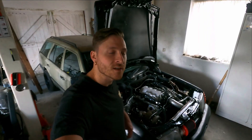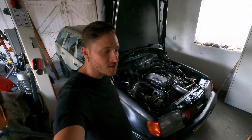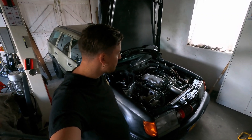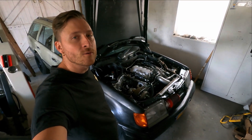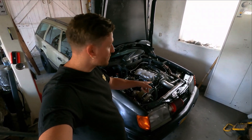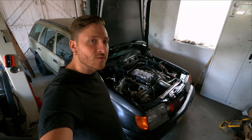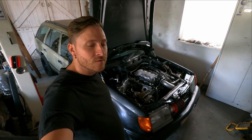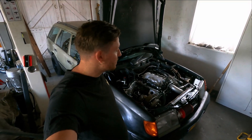Daniel said it can still run a lot of timing with this fuel, and this is a low octane fuel setting. So normally you should expect at a certain point it's not limited. But he mentioned he thought he had earlier knock with a lower timing setting. So that could also mean that the values I put on the crank pulley - the timing setting - are not correct. I calibrated on 15 degrees, so maybe what reads as 15 degrees is actually 10 degrees in real life, or 15 degrees is actually 20 degrees or something else.